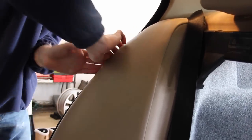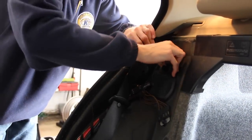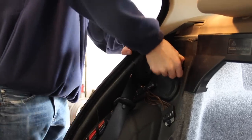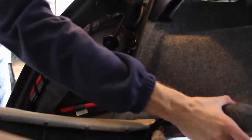If you've got split fold seats, pull that — it's going to make things a lot easier. Once inside, move the seat belt out of the way. This big piece of leather seat panel: access it from the outside of the car and pull out — it will completely remove itself from the vehicle. Note that the fastening clip stays in the car; depress the little tab on it, work it out, and then replace it inside the seat. Press it back in with the plastic clips until it clicks, and then pull the rest of the carpet out of the way.